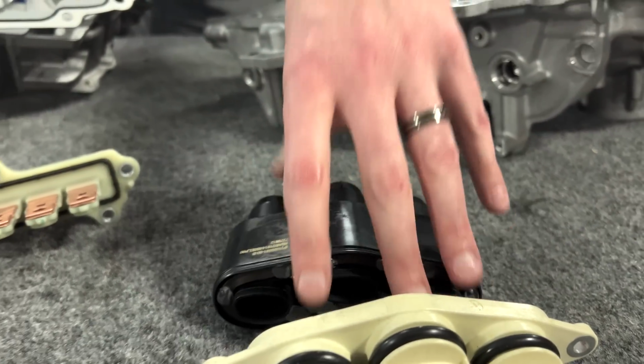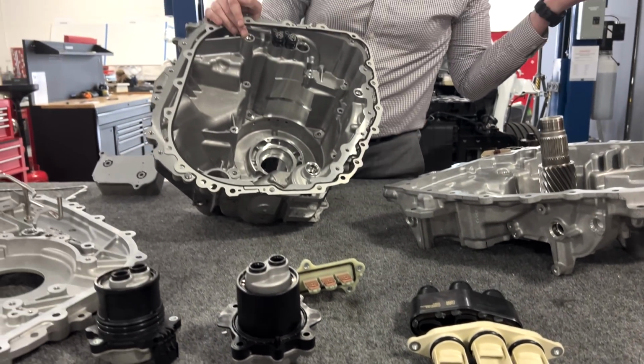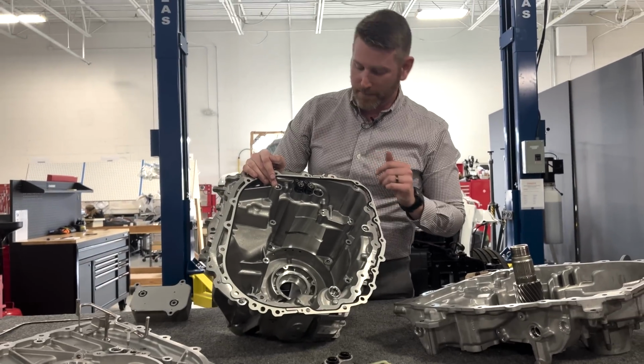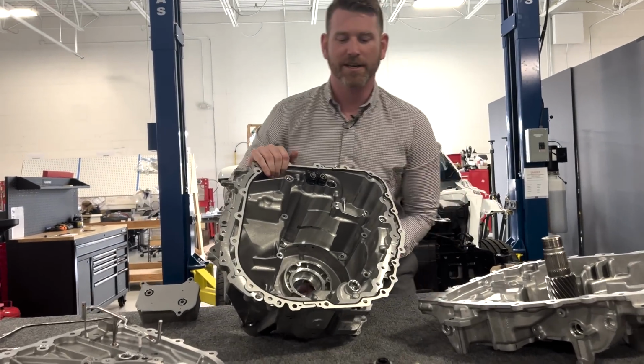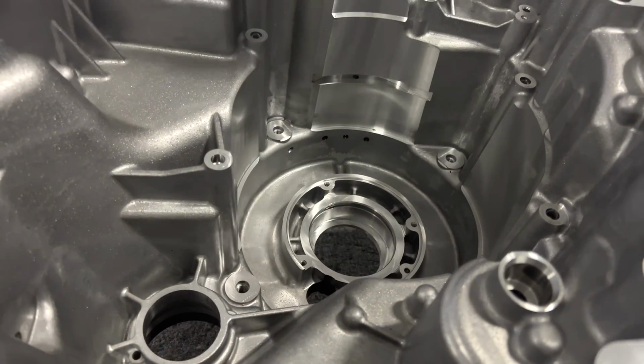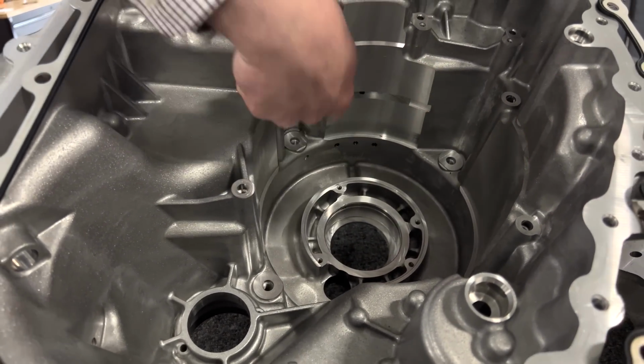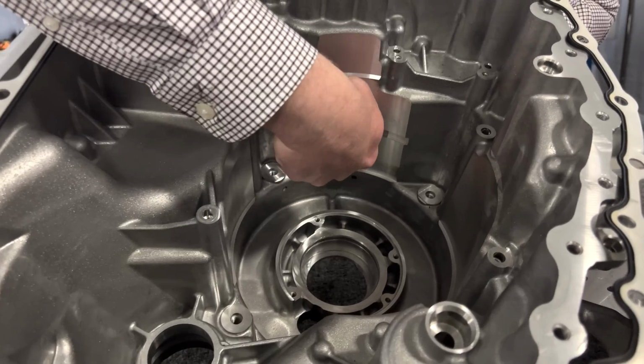So they might be mitigating any of those concerns somewhere else with another system, or just within the vehicle. But you can kind of see, I can maybe get a little closer to you, Grace, through here, this is where the resolver sits, and then there's cooling ports, so they're dropping and cooling the top of the stator here, and then the top of it here as well, there's another port as well.